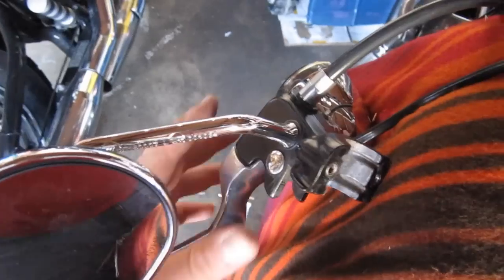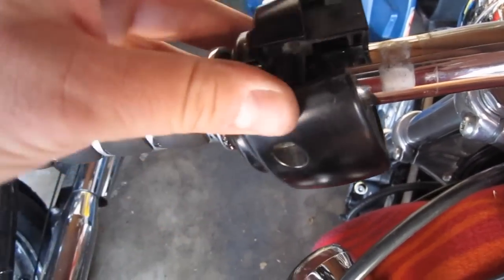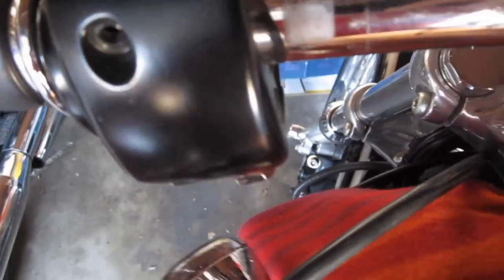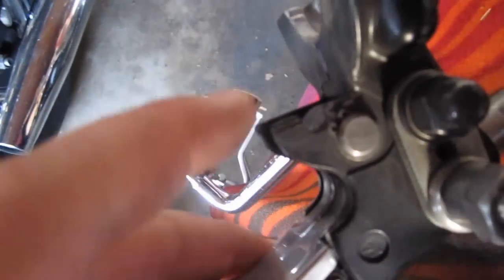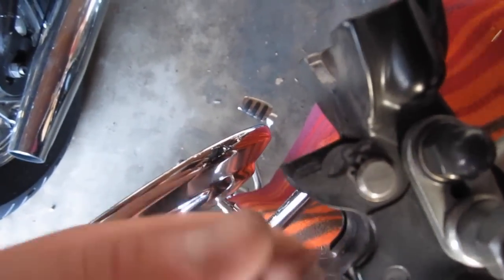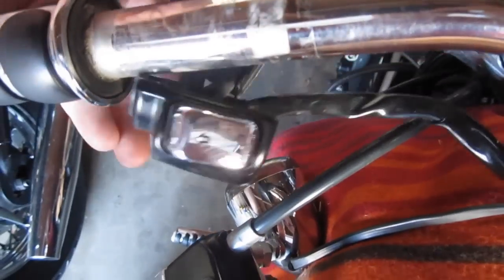This bolt here uses a T25, while this bolt here uses a T27. I got this off here, the other part's sitting over there, and then I pulled these off, and this just comes right off now. One thing important to notice is there's this little notch here, and there's a matching one on the bottom of this right there. You want to make sure whenever you're putting it back that those line up nice so that everything fits on snug. See, this comes off right here.